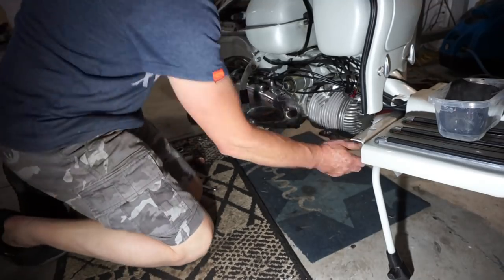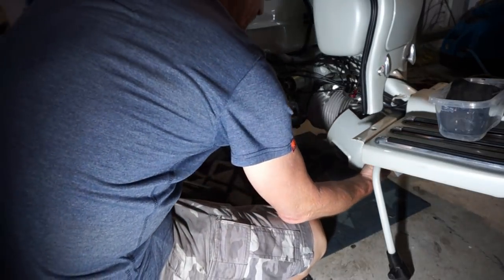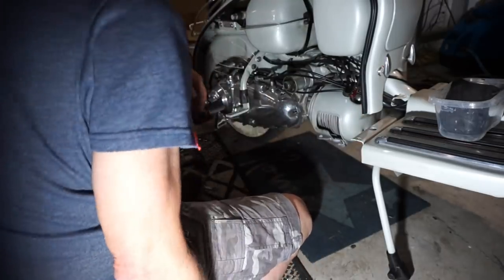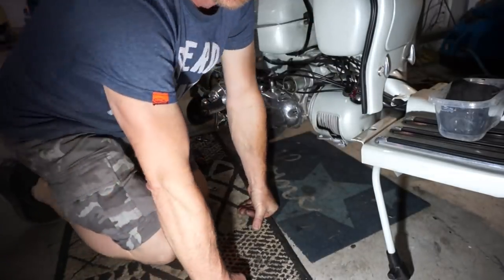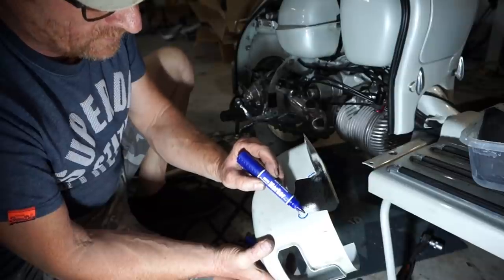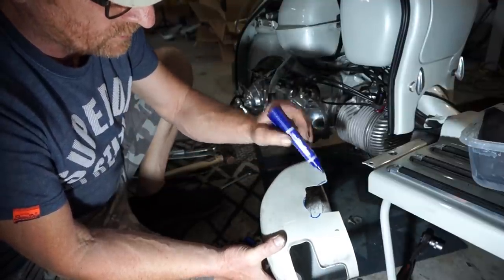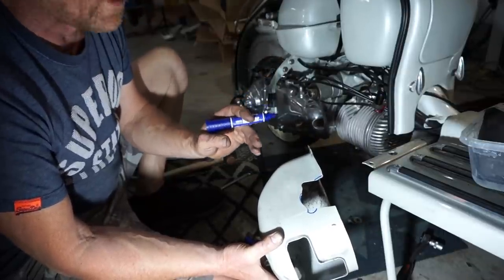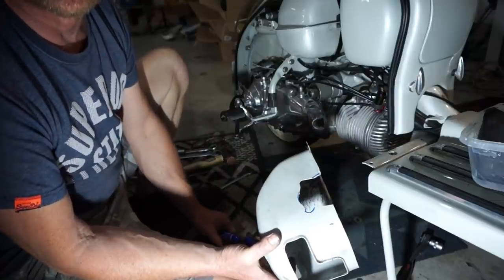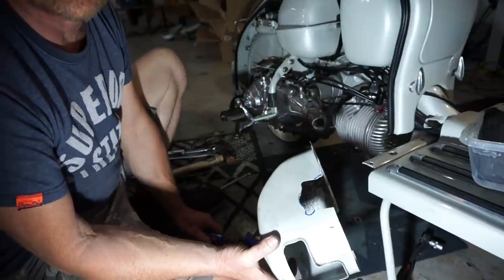We're on. So we're going to swivel the downpipe back a bit, out of the way, and then slide our cowling on. The springs don't touch — there we go, on it goes. So that's with the standard cowling, not having to trim away anything. Unfortunately, it didn't fit straight on, so we're going to have to trim a little bit. But one spring on this side only needs a small amount out there, and just this corner of the cowling off here, to clear the other spring. Nowhere near what you would have had to take out if you put the springs in the original position — you'd end up with half the cowling missing and a whacking great gaping hole, losing all your precious cooling air.